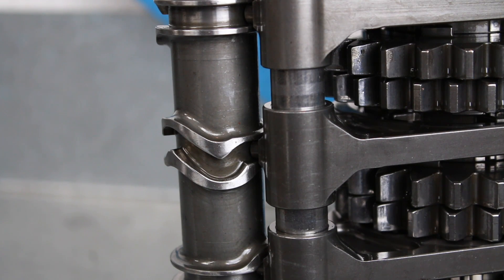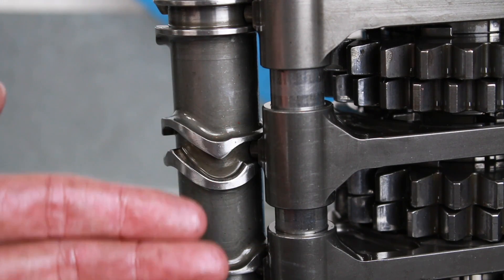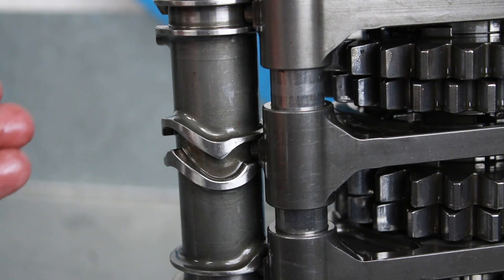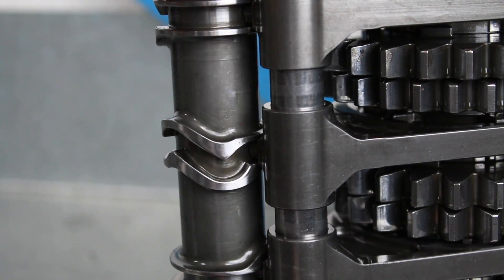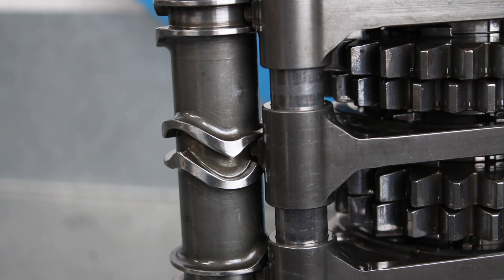Taking a closer look at the barrel, you can see how the channel for third and fourth gear actually rotates and how it shifts that selector fork to move across onto the dogs of the two different gears. You can see as we move the barrel around it moves the selector fork — a really simple but very intelligent and absolutely beautiful piece of engineering. That's all for this Driver 61 video. If you enjoyed this, please subscribe to the Driver 61 channel, and if you'd like me to look inside any Formula 1 parts, let me know in the comments below.